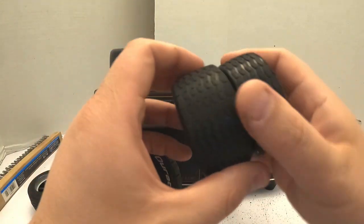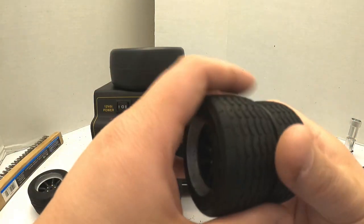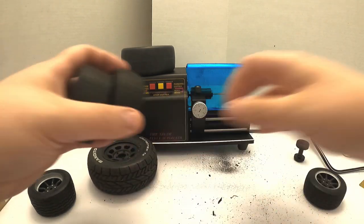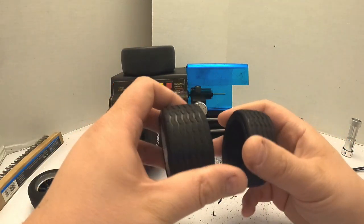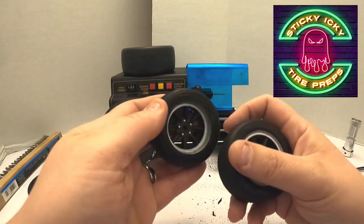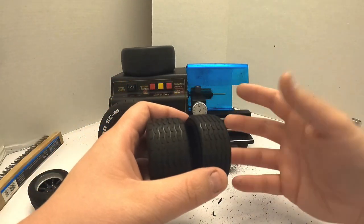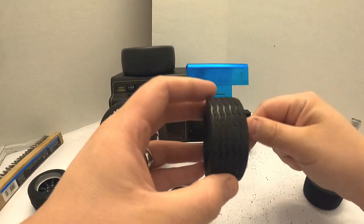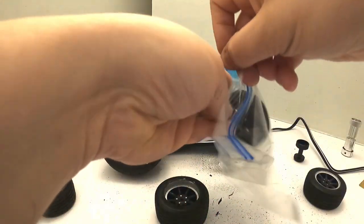Now, what's my next step in the rubber tire prepping process? Now that the tires are pre-broken-in, the treads can soak in preps or conditioners. I'm going to take a zip-lock bag — this method is the same whether I'm talking about drag tires, dirt oval tires, or touring car tires. I'm not going to show the actual application because I'm waiting on my Sticky Icky preps and conditioners to arrive — that's my sponsor, going into my third season with them. I would brush it on with the dauber it comes with or wipe it on with a rag, then slide the tire into a zip-lock bag.